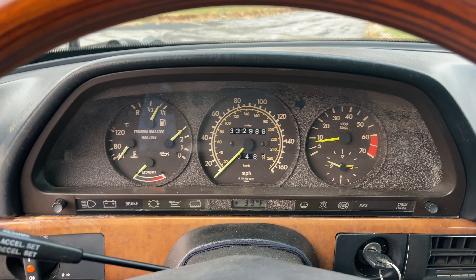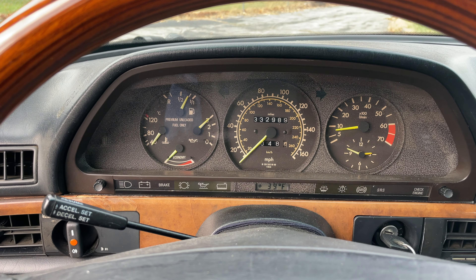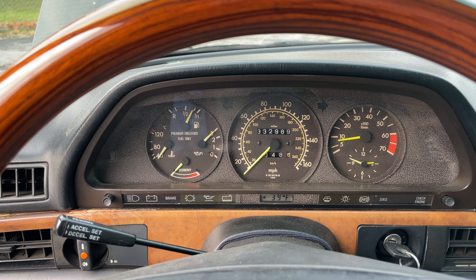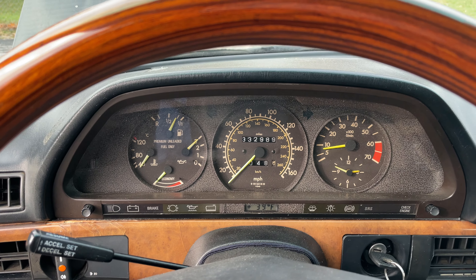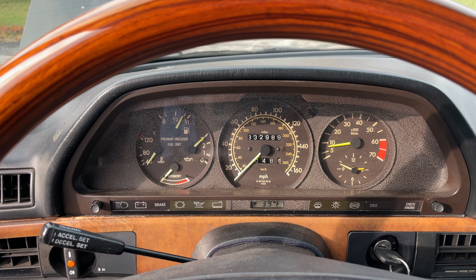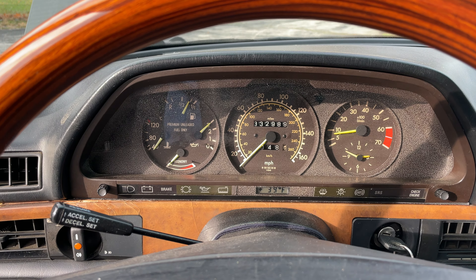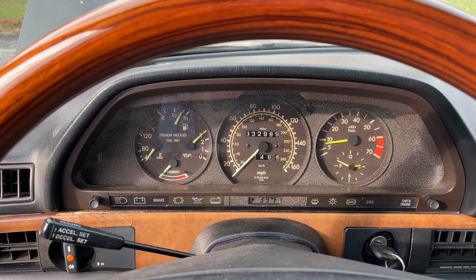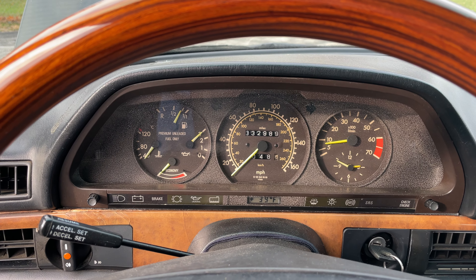This should ensure that the idle speed doesn't go up when the engine is warming up. With older engines, the idle going up comes simply from the valves — the valves won't close as much when they're cold or worn out or when they don't seat right. It's just wear and tear on this stuff. But this fix — releasing the spring tension in the idle speed air valve — will help you through until you actually have enough time, money, or willingness to overhaul the head: mostly the valves, camshafts, and timing chain, ensuring the timing is correct. Then that unstable, rough idle will disappear too.